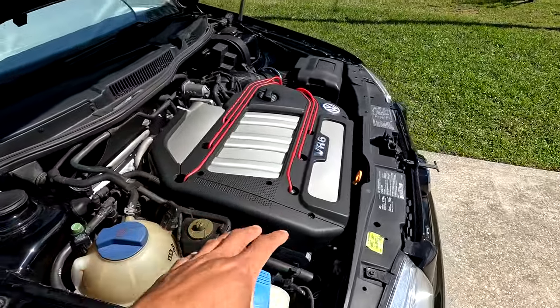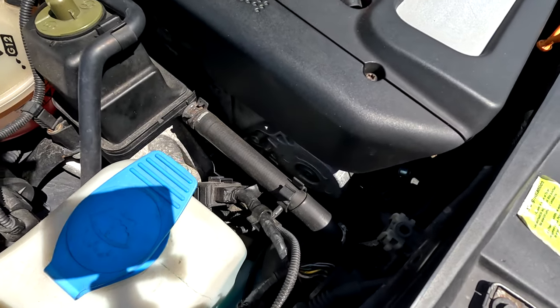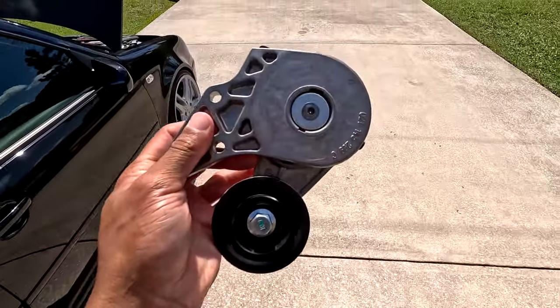It's all from this side of the engine, so we're going to toss on a new belt tensioner. When I did all the chains before, I did a new belt, water pump, all kinds of stuff - but for some reason I put the old tensioner back on. This one's got about 130,000 miles on it, so we'll swap that out and hopefully the sound goes away.